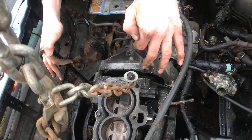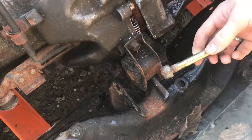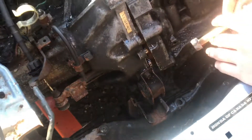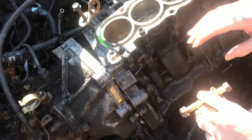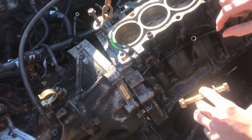We need to get the clutch shaft disconnected so we can remove the rest of the engine. I took out the transmission mount bolt so it can move around a little bit, because if you're jacking this up and you feel anything bind, you don't want to go any farther. You want to stop right there, because this has a lot of power and it can bend and break things very easily.